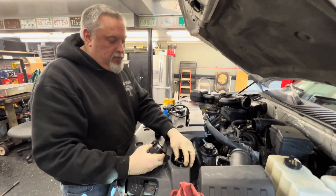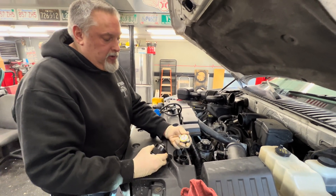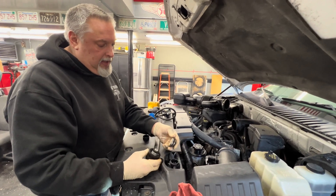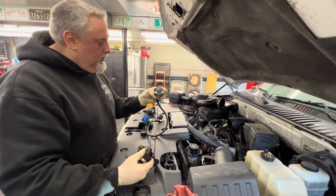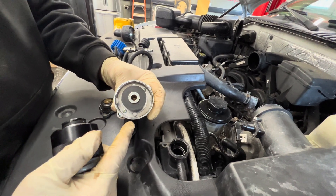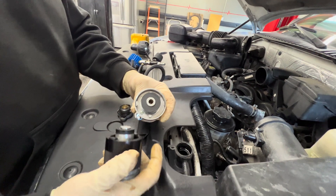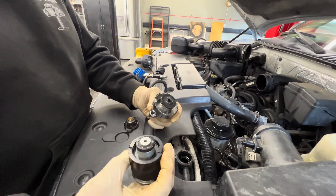This has a smaller radiator cap than the older vehicles used to have. Some of them have threads that thread on, some have a smaller radiator cap, some have the original. There are different adapters that adapt to this. This would fit like an old style 1970 Chevy Chevelle, all the way up into the 80s and 90s, and then they changed everything around. Now you need an adapter to go from smaller to bigger, and that's what we have here.